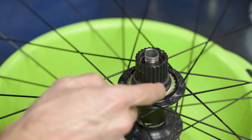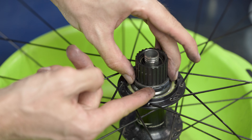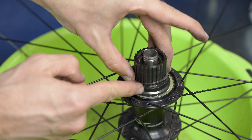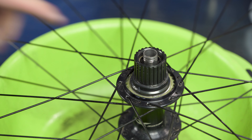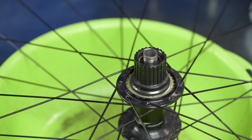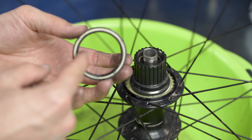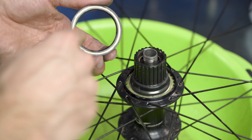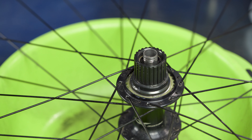So first I go here around the hub. Now you can probably see that we have this area covered with sealing grease — the area which will contact with the sealing gasket. And we do the same with the gasket itself — we apply a bit of grease here. The purpose of this greasing is not allowing water and all other stuff inside.